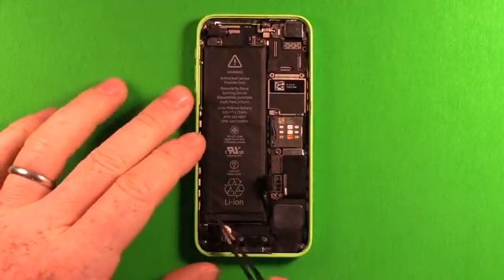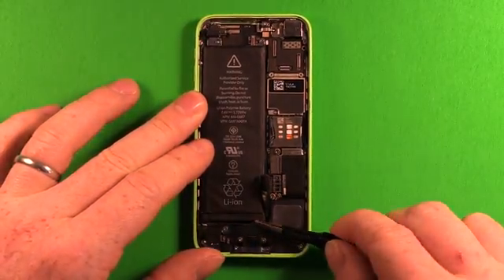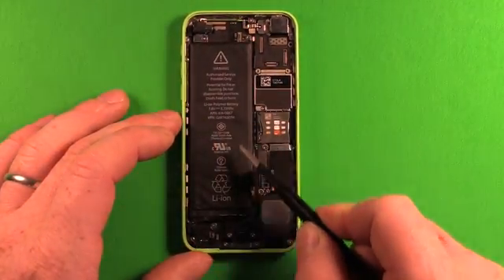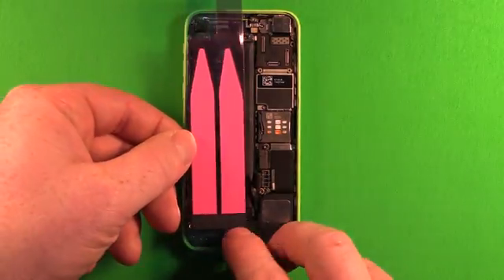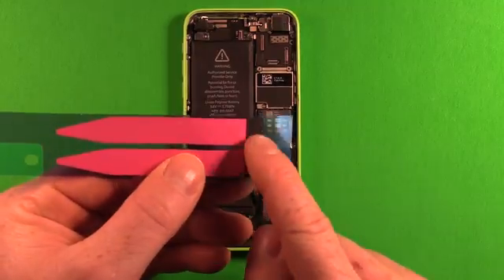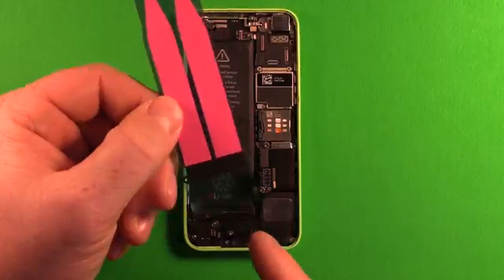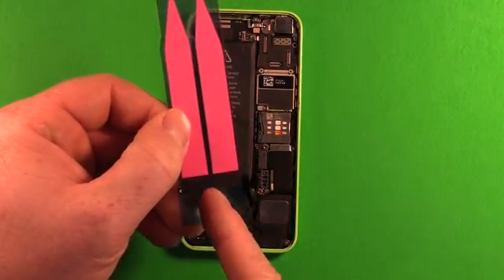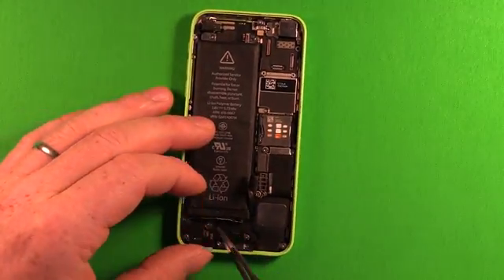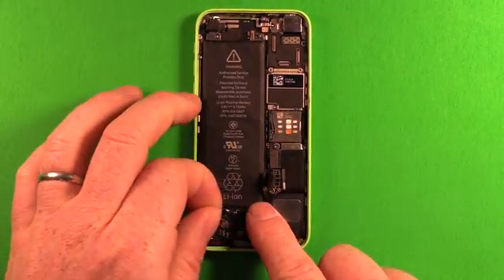Find the tab below the battery and use the tweezers to carefully get in there and unfold the black part. There are two strips running right under the battery. We need to cut these strips in half right at the black part using scissors, so that each strip can be pulled out individually. Now that the strips are cut and separated from each other, we can proceed to remove them.